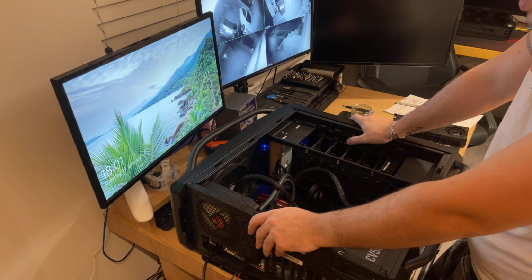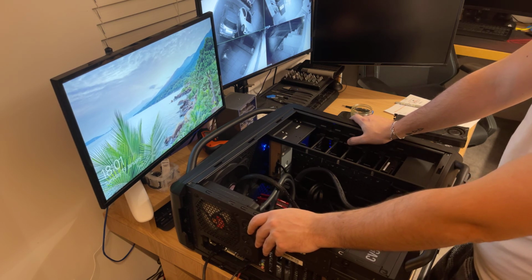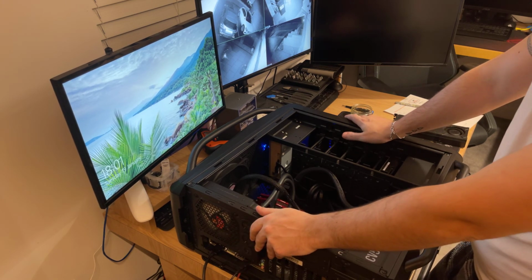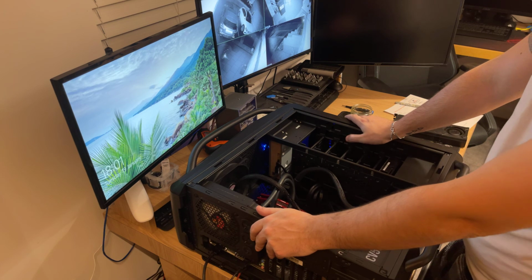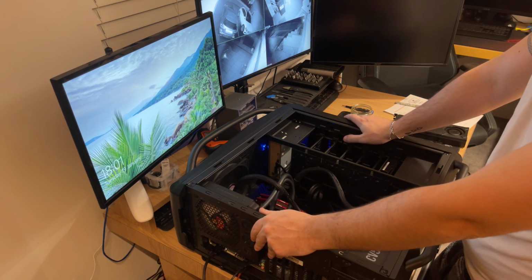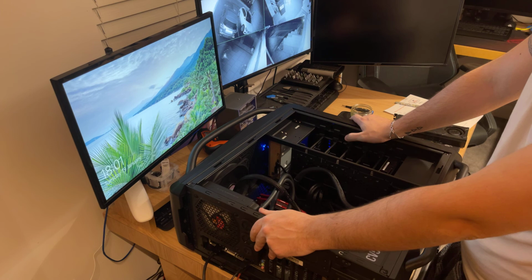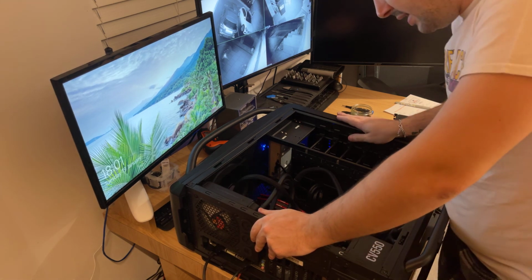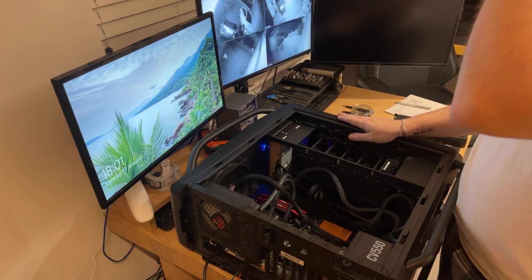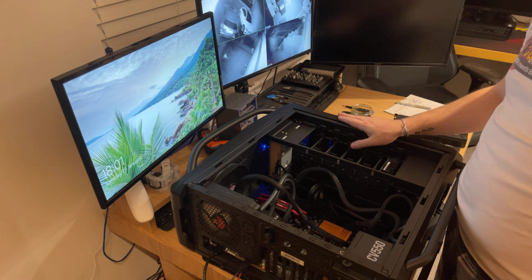And yeah, in this case, we actually got there quite quickly. Sometimes it takes longer. I was actually expecting for these not to really work. And I thought it would be a faulty motherboard or a faulty processor. But it ended up being a graphics card, which I've never actually seen a faulty graphics card doing this, like making the computer not even turning on. Normally the computer turns on, it just doesn't give any image or things like that.